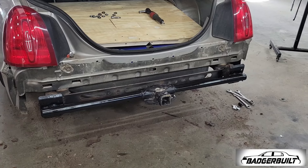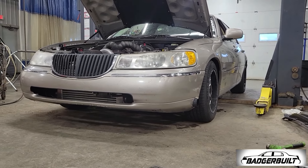We still have to get a hitch on the car, and yesterday it was close to 70 degrees and the temp wanted to rise if I did anything over 60 miles an hour. So tonight I think we're cutting a hole in the front bumper — as much as I don't want to — but it's gotta be functional. Until I revamp the turbo kit to put a full-size radiator in here, I need more airflow, and that front bumper is obstructing that.